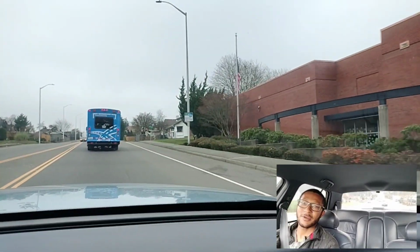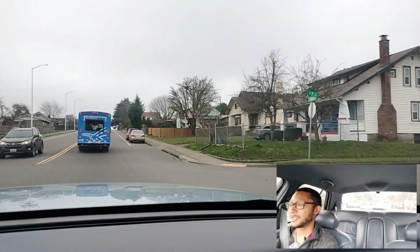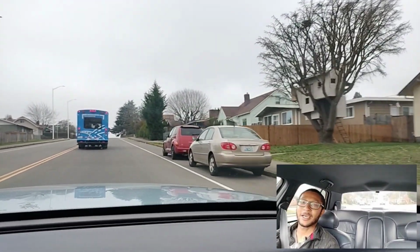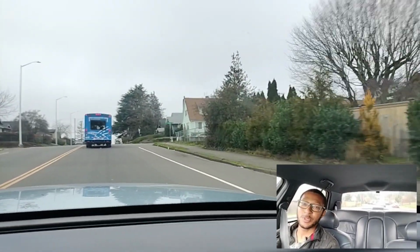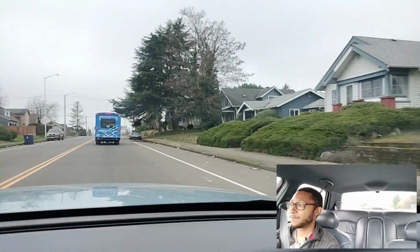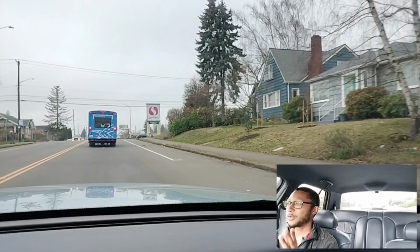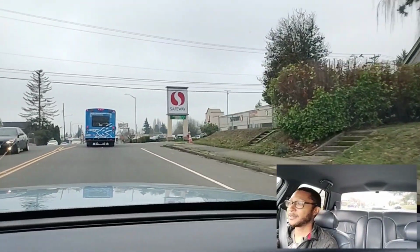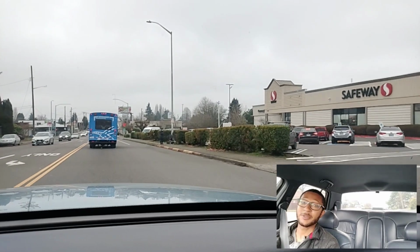But like I said, when you're driving a car, it goes straight if your alignment is straight. That's another detail. You've got to think about your alignment. Once you start replacing your front suspension components, you want to get it aligned, right? To make sure that your car is driving straight. You should be able to take your hands off the wheel in a safe manner, and the car should still go straight. Make sure you put your hands back on the wheel.